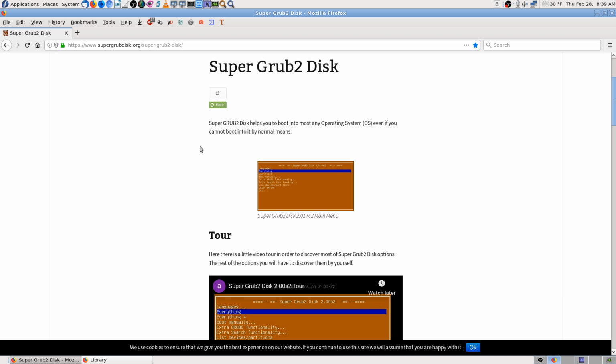So what I want to do is just see if I can get this machine to boot. The last thing I did was reinstall again, install Grub on the hard drive, and then try to use one of these rescue systems to install Grub onto the SD card. I tried it a couple of different ways: boot it up to install Grub onto the SD card, then boot to the hard drive, and set up Grub 2 on the hard drive to point to the SD card, because the BIOS can't see that SD card as a boot device.